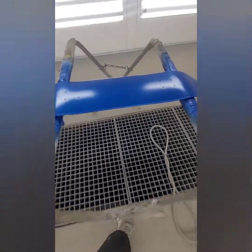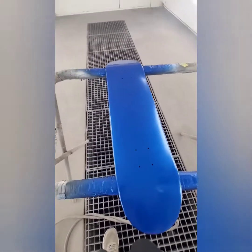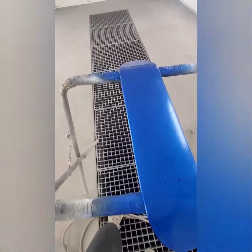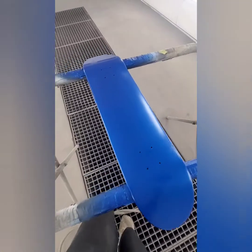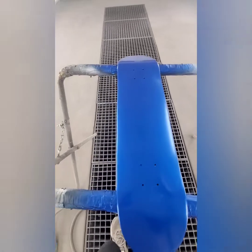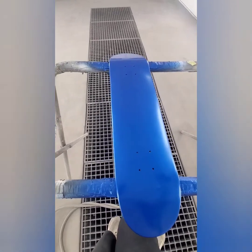But when you're trying to match panels or match a car, if you're blending into it, always go by what the color says for what value shade of sealer or primer you need to use in order for coverage. You never want to stray away from that, but being this is a custom panel we're doing, I'm doing it exactly like I did the truck. That way, if it does sit next to the truck, it's going to match exactly like the truck.